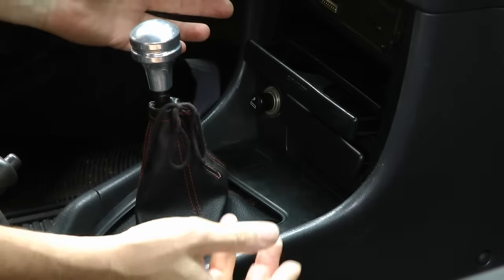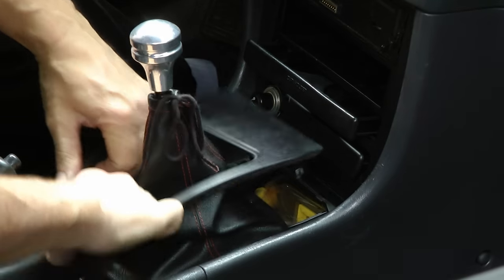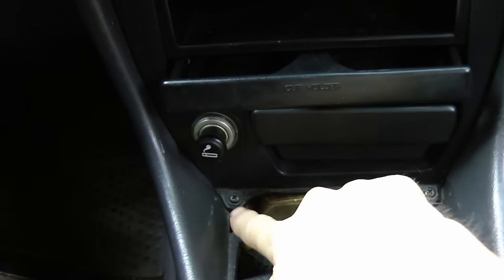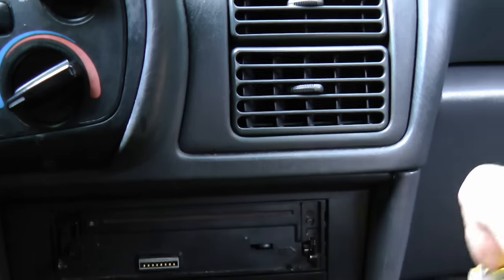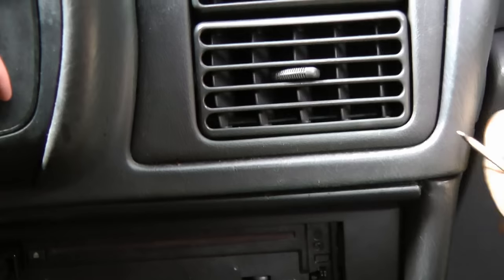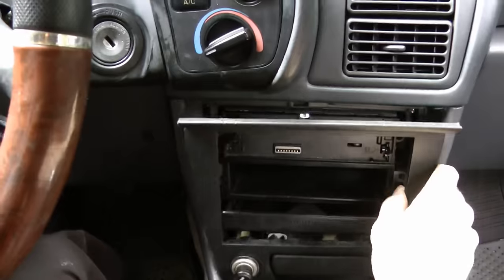Now to get the radio out of the way, first you got to get the covers off. In this case, the bottom here just snaps off, and then there's two little Phillips screws you take off for the front cover. So you remove them both, then get a skinny little screwdriver like this to take the front off. Because the top part here is real tight, you get the screwdriver and you pry it off. Be careful not to break anything off, but eventually you'll be able to pry the whole thing out and pull it out. And out it comes.